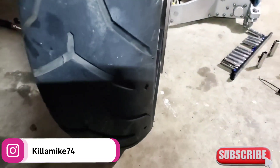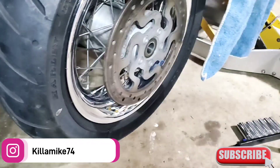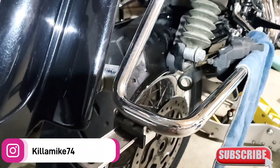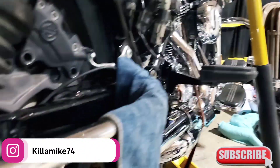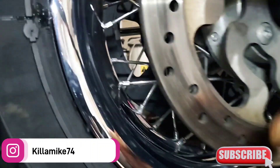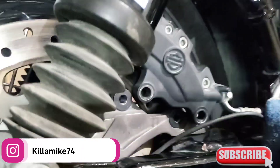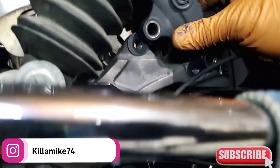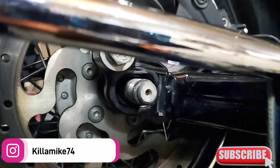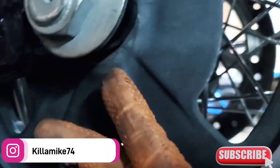You can see that's the new tire, and all that other stuff is gone. About to get this tire mounted up. So I got the tire up, got the axle through, and I greased it too. I got the ABS sensor right there. This is the bracket for the caliper right here. On this side I got the belt on, I got the spacer back here, and I got the axle in — so we basically got that sorted.